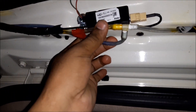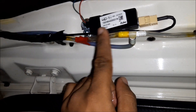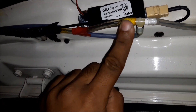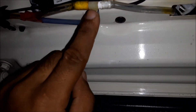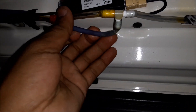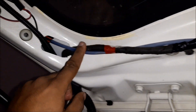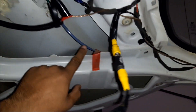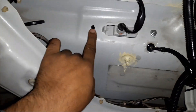This is the tapping I have done by placing a tee in between. The line is taking water from this one — this line is coming from the reservoir from the motor, and this is going to the factory fitted washer. I placed a tee, and it's going to the new nozzle, traveling all the way behind this panel and coming out here.